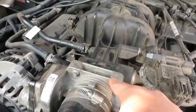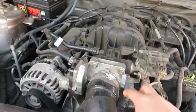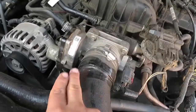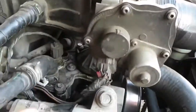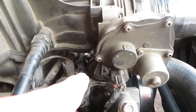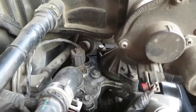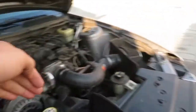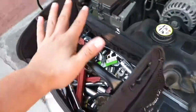First things first, I have to take off my intake, then move to the throttle body — take off these four bolts on the bottom, and this pops out. Then I have to remove that bulb and the one back here, and take off the hoses. That one's gonna be hard to get out. After that, I'll put the new one in, do a radiator flush, clean out the whole system, and clean my engine. Here are my tools — it's super cold outside, but gotta do it.